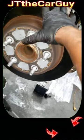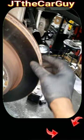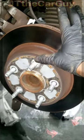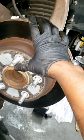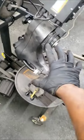I'm getting ready to do a brake job on this 1500. I'm going to resurface the rotors — they did pass minimum specs, so they are resurfaceable. You do not have to replace rotors just because you're doing a brake job. I know everybody likes to simply replace them, but I'm going to resurface them and put on new pads.